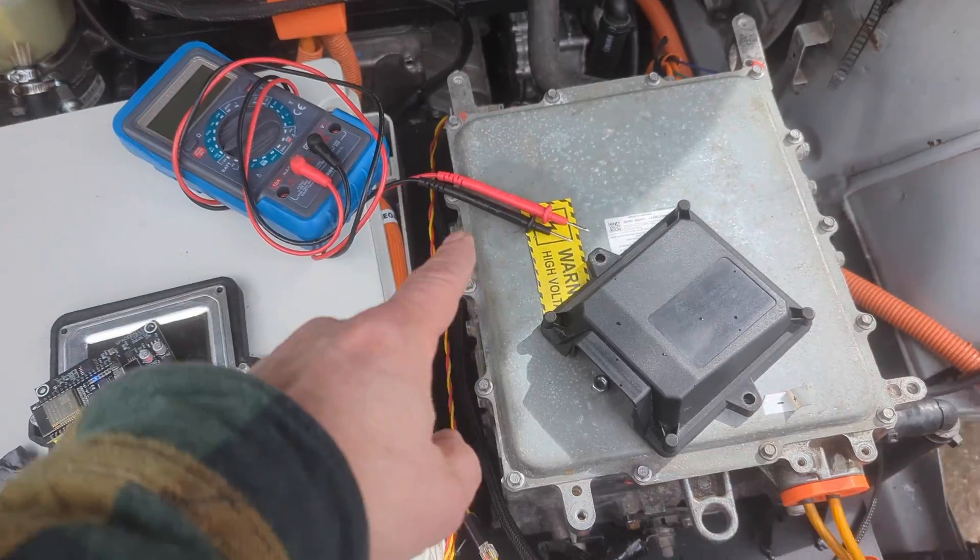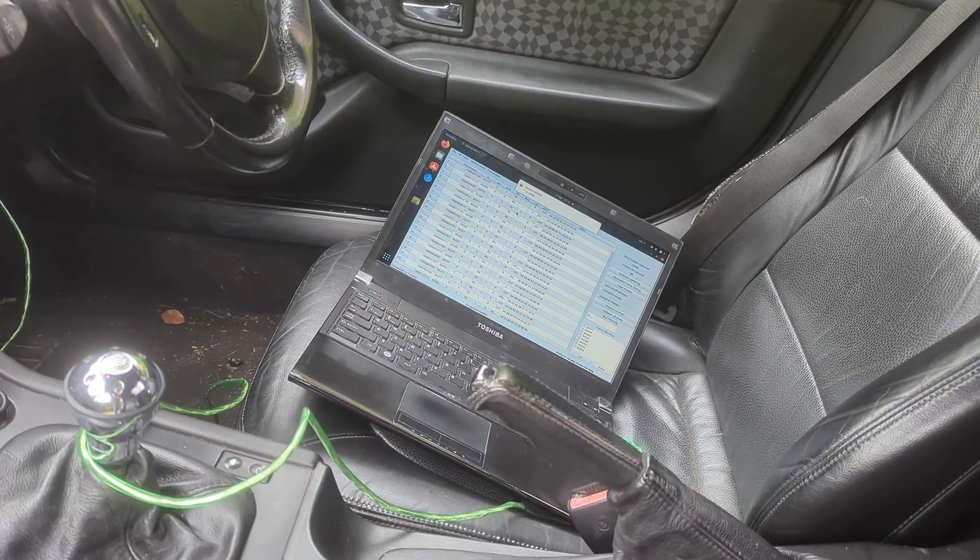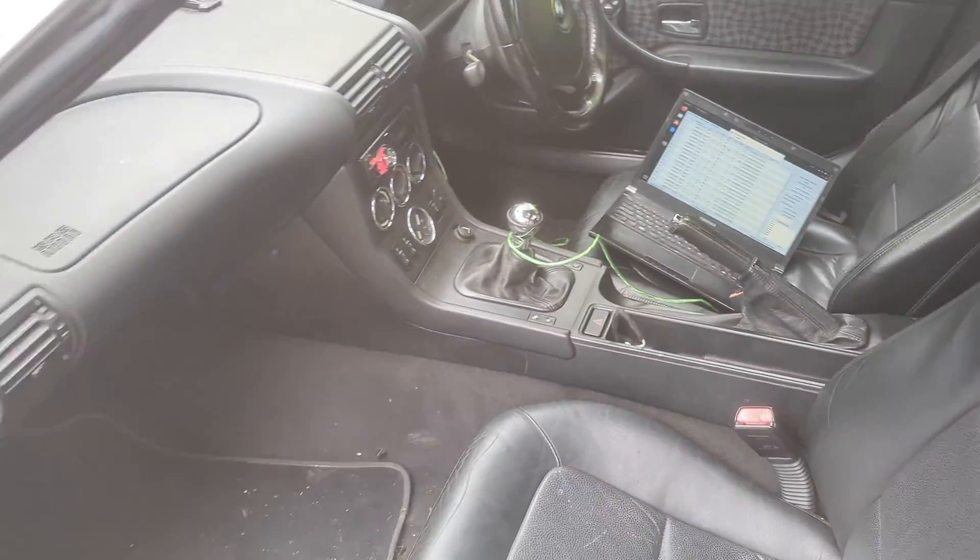But if I stick the same Savvy Can onto the charger and plug that in, we get lots of traffic. So what does that mean? I suspect it means that the battery box has to come out — that I've put the two blue plugs on the version 2 modules back to front, and therefore the connector out of the master module is not giving me anything. So the battery box has got to be opened up; whether or not I need to disconnect all the cooling stuff, we shall see.